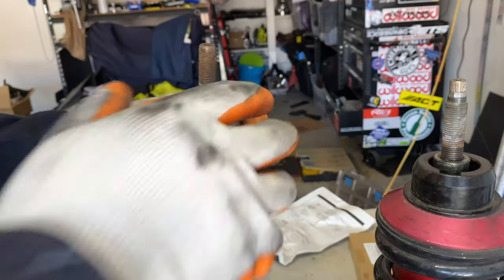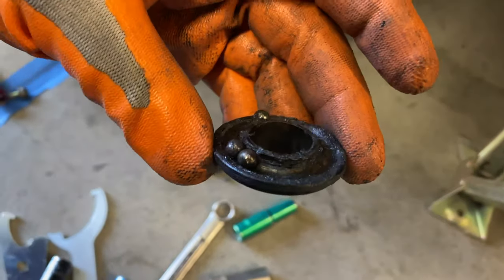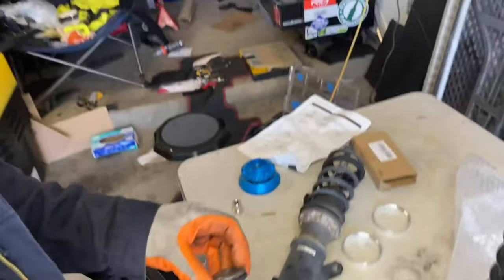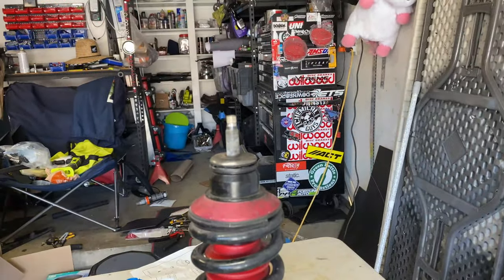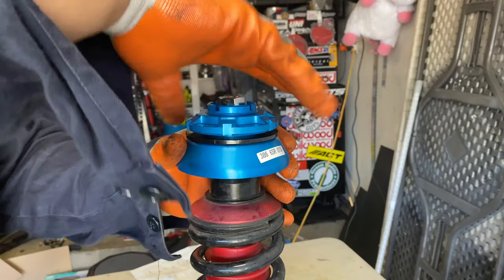I didn't really get to show you guys this last time, but let's see what this one looks like — it looks like it got torn up. Here's the bearing that goes in between there, and these bearings are just shot — look how blown they are. I'm going to have to get new ones when I replace those for sure. These are also split, but it's better than what's on there. This is a temporary setup until I rebuild these BCs, so that's the only reason I'm using them. So we got the bearing, put on the spacer on top, put this guy on top, then throw this guy on.